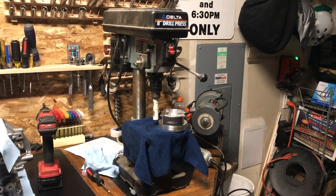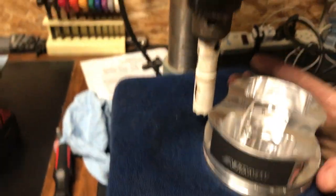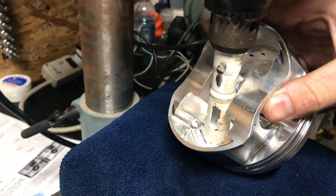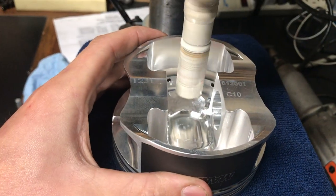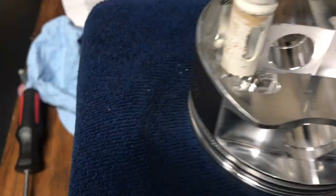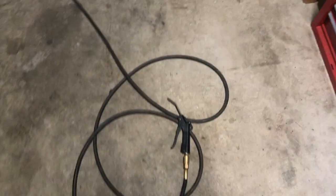This is the system I actually came up with. It's a hole saw that I will take and slide the piston underneath through, making sure not to scratch anything. Then I can turn it on and lower it. When I'm lowering it, I'll take the piston and move it around — that's why I've got the microfiber down. That will give me a nice flat surface. And when I'm done, just take it and remove it nice and carefully, not to scratch anything. Then all the shavings, you blow them out with the air nozzle.